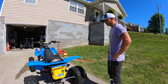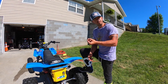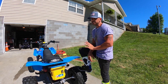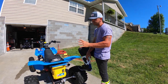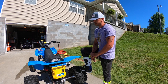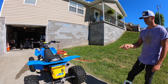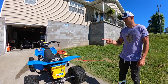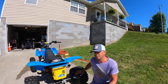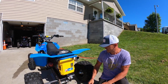And I noticed that already the rubber grommet, or this little rubber-like plunger on the bottom of that master cylinder, without ever having ridden this quad, also keeping the quad the entire time in the garage, so no UV damage, that grommet had just cracked all apart. And so we ended up going back full OEM on the rear master cylinder and on the rear caliper. We did go with, and I've been very impressed with this brand, and I mentioned this in my last video, Outlaw Racing on our disc, on our rotor in the back.